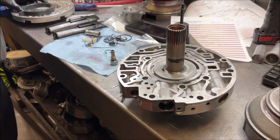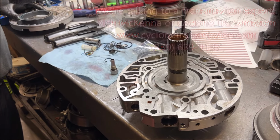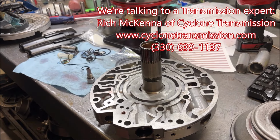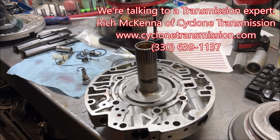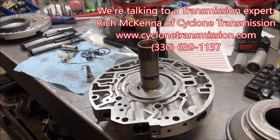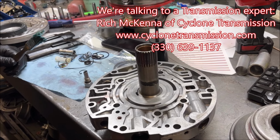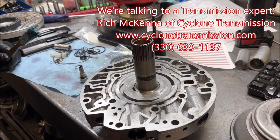So what we're talking about here, I was asking you about proper torque converter placement on a 4L80E. And I think what you told me was you should push it all the way back, engaging the pump. Then the torque converter, from being all the way engaged, should be between 0.125 or 1/8 inch to 3/16 of an inch, which would be 0.188, right?